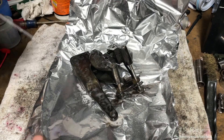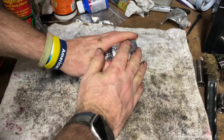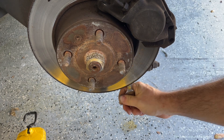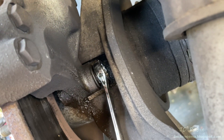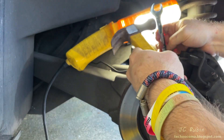The night before, I also started an application of degreaser to the entire e-brake assembly on both sides, wrapped it in tin foil, and put it off to the side on the bench for later. Just like the front, I'll use percussion to break these bolts loose gently, then just a couple turns to make sure I've actually broken it loose and not broken the bolt or stripped it out. I set up again for the top one, same process.